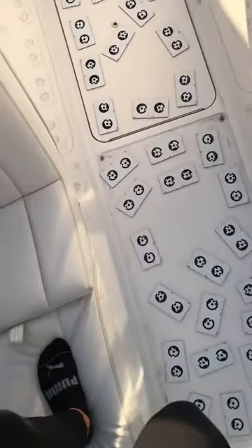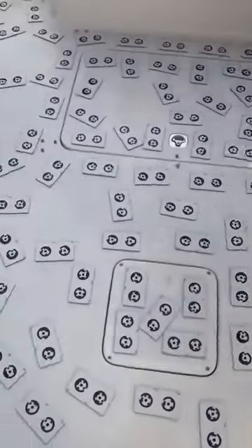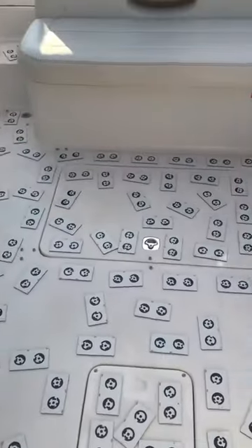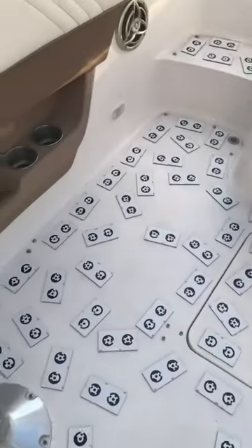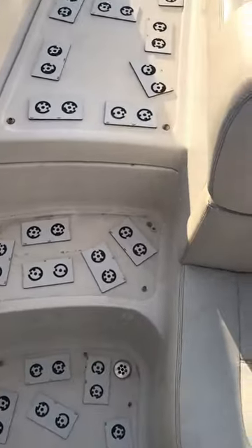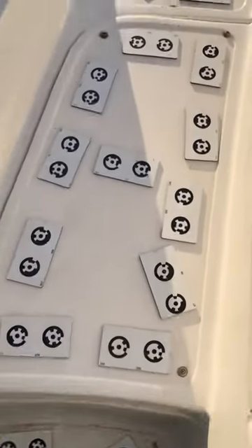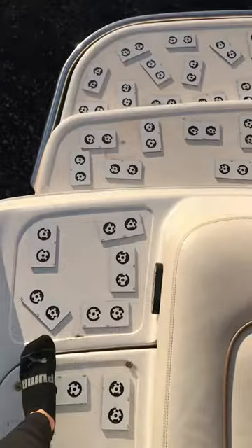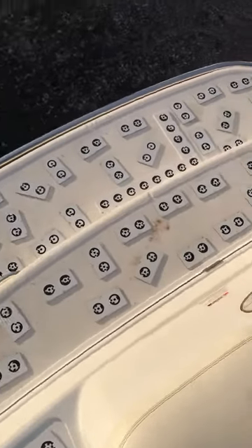A lot of boats hang over the end of the trailer and they're really sensitive to positioning. If you get it two inches too far back — say you didn't pull it all the way up to the stopper and left it two or three inches back — even watching your mirror, the nose will bounce. If you go really far back you can feel it sway side to side. I've seen it a lot, and a lot of boats hang over the end — trailer manufacturers don't always account for that.